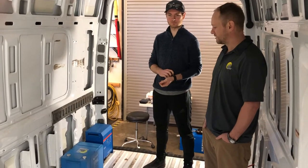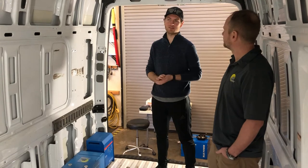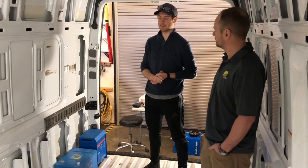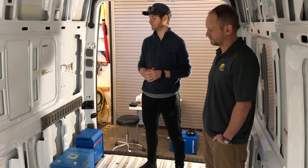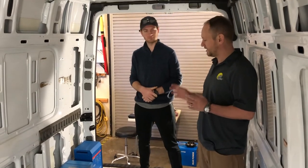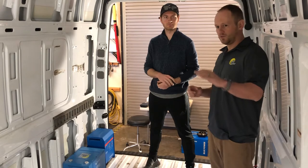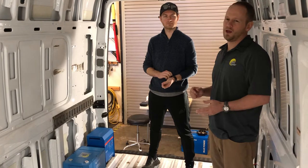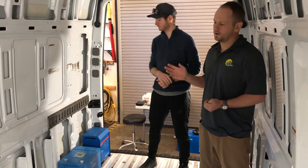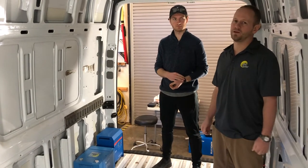Let's talk about the alternator charging system. These vans typically have a 160-amp alternator pre-installed from the factory — that's standard for these types of vans. With lithium batteries, we're going to be able to soak up almost all of that using a bi-directional relay installed in-line for the alternator. It's called a Victron Cyrix LICT. When it senses a charging source on either battery — the Victron batteries or your starter battery — it closes the connection between the two. When your alternator turns on, it will close that connection and charge or maintain your starter battery, which usually takes about 40 amps. The rest of the current — dependent on the alternator rating, charge status, and RPMs — goes to the lithium battery. The system is designed to handle 200 amps, but it's very unlikely you'll get that much charge.